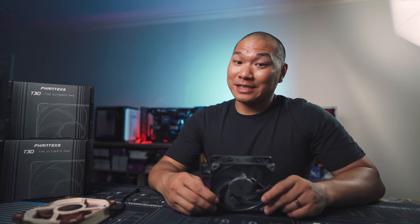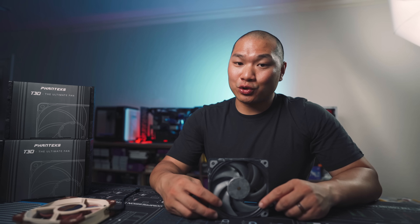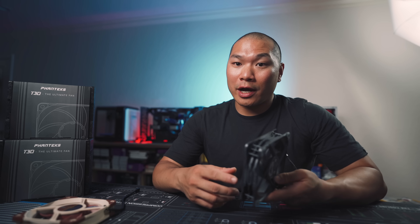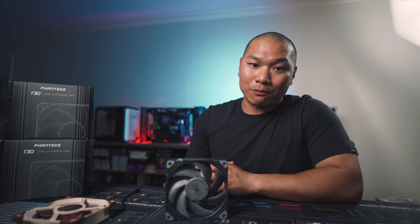These things move a ton of air at 3000 RPM and they seem loud, but I've actually had stock AIO fans at 2000 RPM that measure in as loud or louder than these at 3000 RPM. Overall this motor is great — there's low noise, no whine or abnormal noise at any of the RPM levels tested. Since we know the RPMs that produce equivalent noise levels, let's examine the thermal performance at each interval.